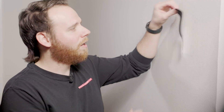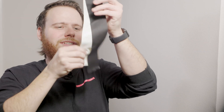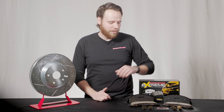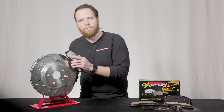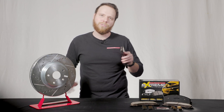The reason this is important is explained in simple terms via the tape analogy. If you stick tape to a wall, it sticks okay and peels off relatively easily. But if you stick a piece of tape sticky side to sticky side, it's almost impossible to separate. Adherent friction works in a similar manner – the pad is adhering to the thin layer of pad material on the rotor, and the making and breaking of those many small bonds causes adhesive friction and helps slow the vehicle.